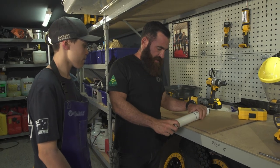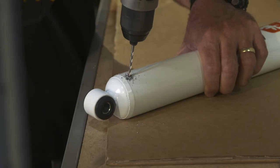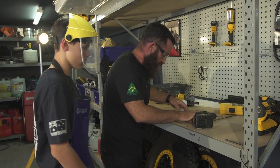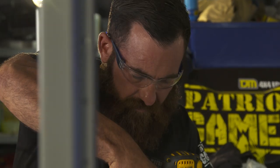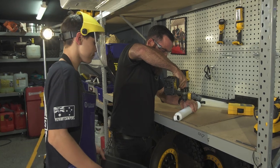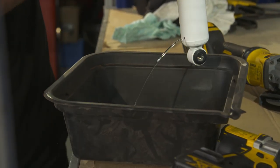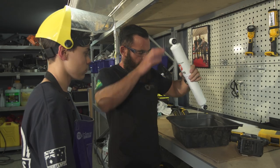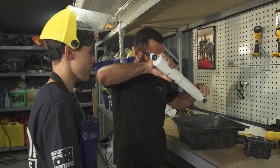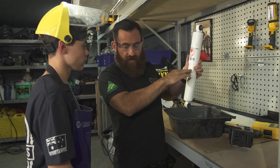Like I said, I've never done this before, so there's a chance it's going to go pear shaped. Let's get a hole in there and see what happens. We'll bang another one in up here and drain the fluid out of both chambers. See all the fluid coming straight out the bottom? The hydraulic fluid is in there for damping. As the piston runs through the fluid, the fluid is what's slowing that piston down.